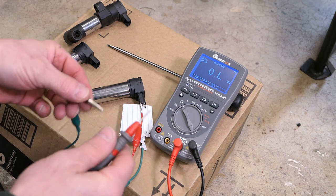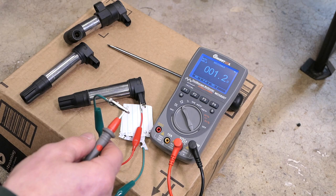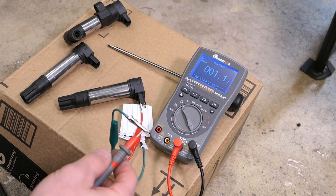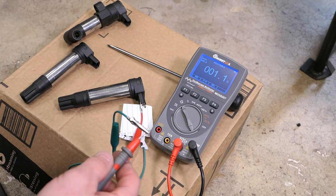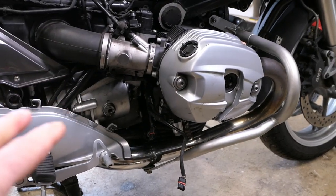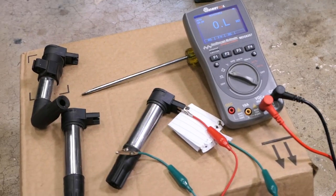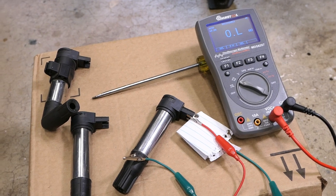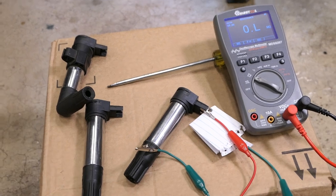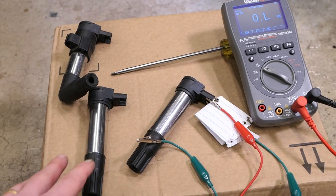Let's try one more — this is the third coil. And now I'm getting 1.2 to 1.1 ohms. So again, right within the range I would expect to see. If you're getting anything in that range, you're in good shape on the primary side. So that's really all you can do: use your two shade tree tricks, test the primary side with a meter, note that the secondary side cannot be tested based on my results, and compare readings across all four coils. If one is way out of line with the others, that's definitely something to look at in more depth.